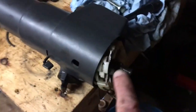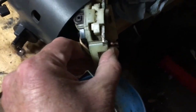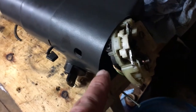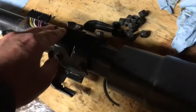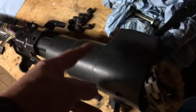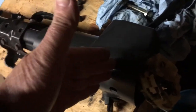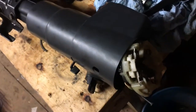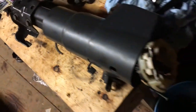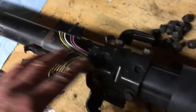The next thing you do is there's four screws. This is your turn signal mechanism — it's kind of stuck in there because the wires have got it pulled up in there. There's four screws in there — they're 5/16 hex head screws, four of them. What they do is they pull this metal steering column up against this plastic housing. And there's a metal kind of half-moon piece of metal in there that the steering column rests on, so it's not pulled up against the plastic directly — it keeps the plastic from being damaged by the steel of the steering column. It's more of just a mounting plate. Once you take these four screws out, this entire steel drive shaft pulls out of this housing.